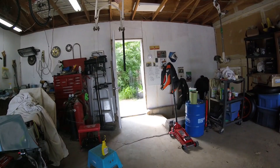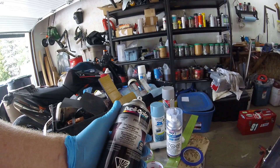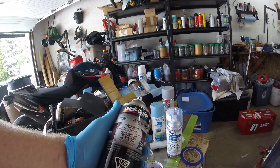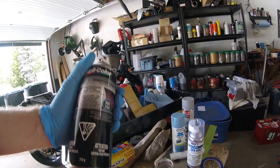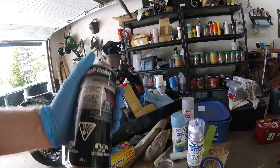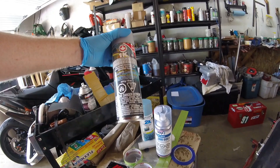Once the scuffing was done I went into the backyard, washed it off with a garden hose, gave it a good wash down, let it dry in the sun, and then started the real prep process. I picked up Dupli-Color automotive prep multi-purpose foaming prep cleaner, and with some blue paper towel I wiped down every panel at every step. The good news is you let the paper towel dry out and can reuse it.